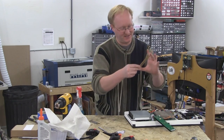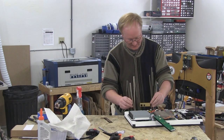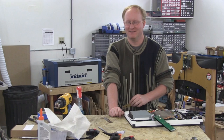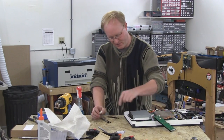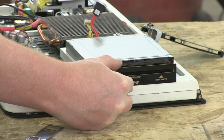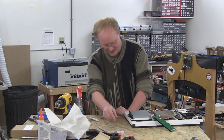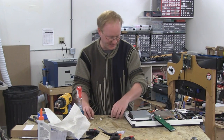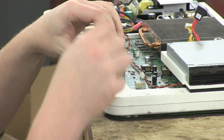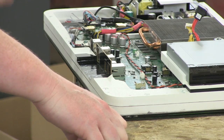I'm going to add a few laser-cut plates. This one is for the Blu-ray and this one is for the back panel — the USB port, IR, and Ethernet. I'm covering up the Kinect port. I'm printing another bracer to put in here just to add support. I'm doing this one bit at a time because it's always good to have the actual real parts in your hands — that helps you figure out how to design the next part. If you design too much stuff at once, none of it might work and you have to start over. I'm gluing the plate to the connectors themselves, so if we need to take the motherboard out the plate will come with the motherboard.